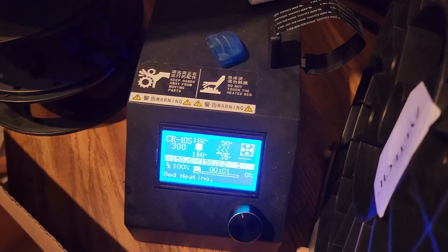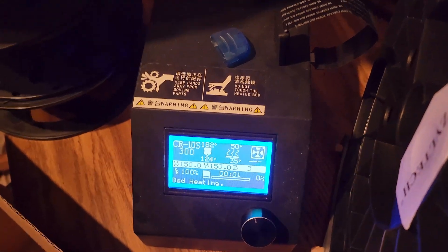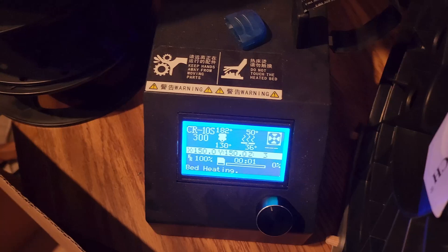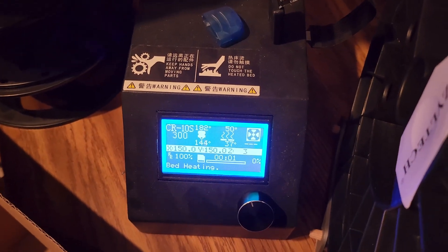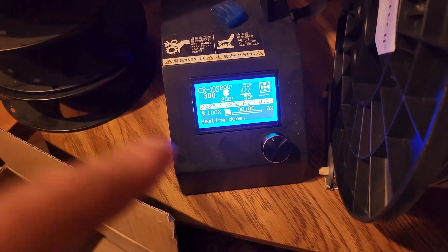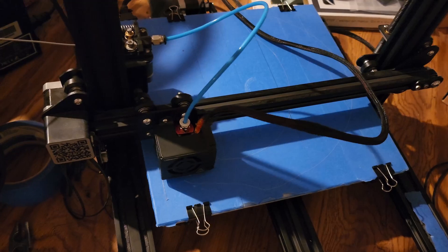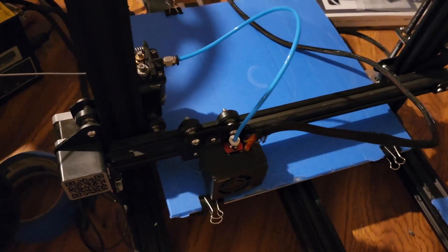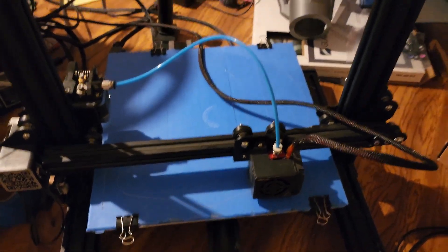Make sure it's working. Hey guys, so I have my printer preparing to print something. I used the menu to set it so it could heat up while the bed is also heating up, and it's moving normally. We're going to see what happens when it gets to the right temperature. So far it's going well. Okay guys, it did get up to 200 degrees and everything is printing — I got a first layer coming out. It's super thin right now because I replaced stuff up there, but it is coming out like normal.